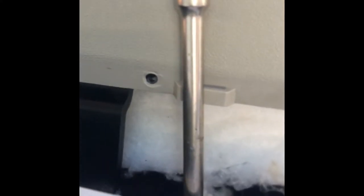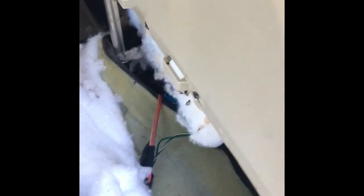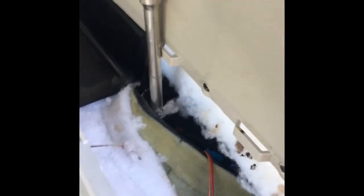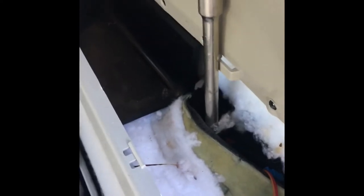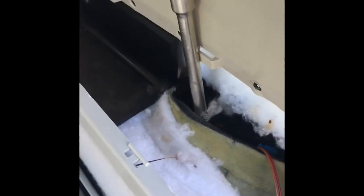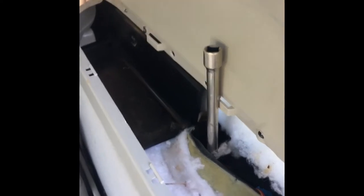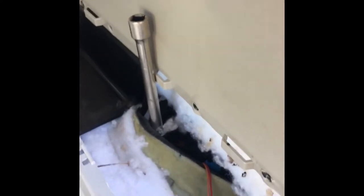About an inch and a half straight down is the other one. Pull back on that insulation as you unscrew it — it's kind of tight, but that's the whole reason we moved the cable. You need to get some room in there; you don't want to break any wiring. I didn't have to disconnect that wire — it's just coming with it. Now, the reason you don't want to jack the car up all the way is that you'd be putting stress on the nuts on top. You want them to relax so they're easier to take out. When you lift the vehicle, the two studs mounted on that shock will actually drop out of the hole for you as soon as you take the bolt out from underneath.